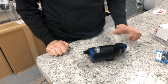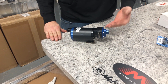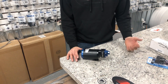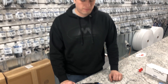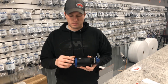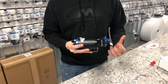When I said that the size is important, what I mean is this is the inlet side. It's only a number 8 ORB, which would lead a lot of people to believe that it needs an 8 O-ring or 8 AN hose coming to it, but it actually needs a 12. I always feed this pump with a number 12 — it doesn't hurt anything and it makes it live longer. You always want to feed a fuel pump with more fuel than it can actually pump out the other side, so that the inlet is not a restriction. Whether you have a 10 or an 8 out, a 12 is what you want coming in. This will help keep it cooler and give it the ability to hit its maximum power potential.